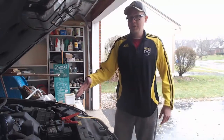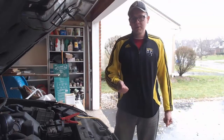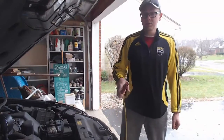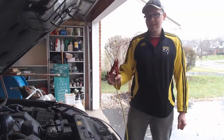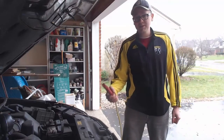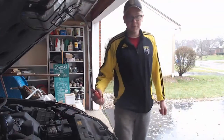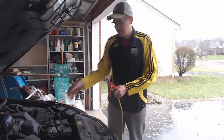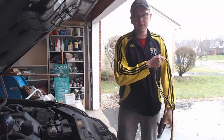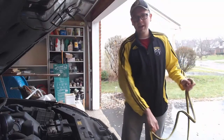After you've gotten the previously dead vehicle running and need to disconnect your wires, do everything in the opposite order — literally reverse the whole process. Take the positive clip off of the dead battery first. Hold it — don't let it drop, because it still has electricity running through it from the good battery. Take the red clip off the good battery, then take your negative clips off. Coil up your jumper cables, put them back in whoever's vehicle was responsible enough to have them, and drive yourself to the auto store to get that battery checked.